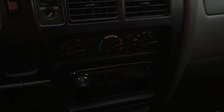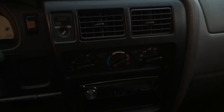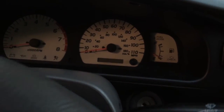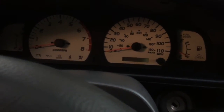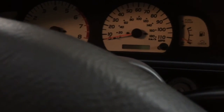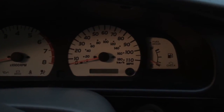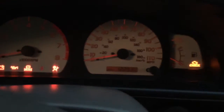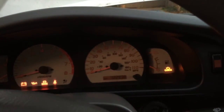95 to 97 do not have a digital speedometer, so those really don't swap. 98 to 2004 — I've only messed around with mine. I know that in 2001 they went to these white face gauges; they used to be black like my stock gauge. If you want to keep the black one, some people have said they've done it — they've put the 98 to 2000 ones in to retain the black face gauges. I always like the white face ones because during the day they're white and black, but at night they're darkened with the orange light.